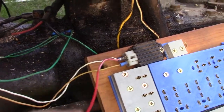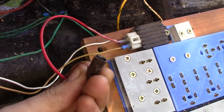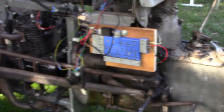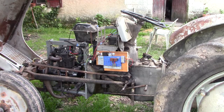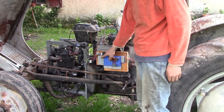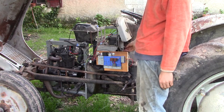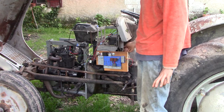When I unmounted everything to make the connections, I found this charging device. It has a wire that has to be connected to the plus — before it was just on the battery, but now I'll connect it here via this fuse. Now that the most important parts are installed — the main relays, the fuses, and the fuse for charging the battery — let's see if the relays click when I turn it on. Yes they do, at least one of them.